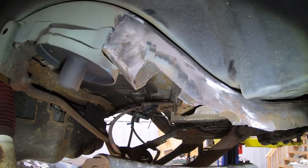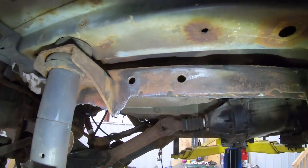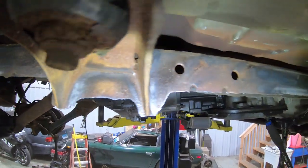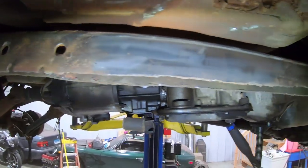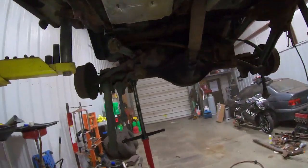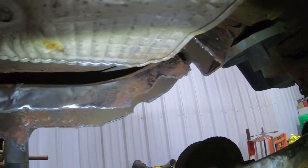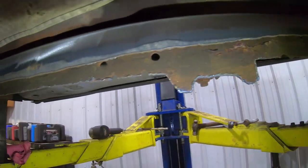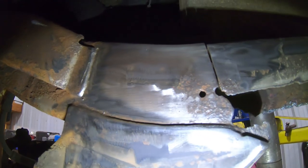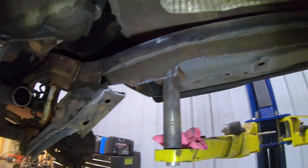The passenger side is all cut out now. Literally half of the frame is gone. We cut around the body mounts and cleaned up everything all around because we're going to weld inside there as well. This whole section went around that body mount, we cut out all the cancer over here, and cleaned up over here. We ended up cutting a little bit higher - the sway bar mount is out, exhaust mount is out, all that stuff is going to get covered up. We go all the way down, it's all prepped and ground down. We come to that big crack - we're going to do a little bit of fill work on that before we go ahead and plate it so that we have double the strength. We're going to weld that crack up and then throw the safety cap up in here and weld that in.